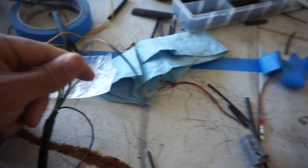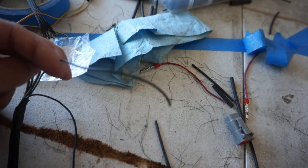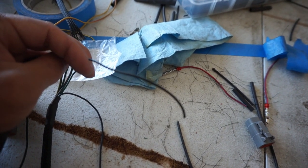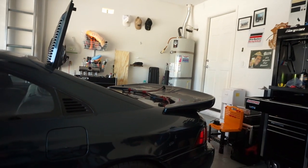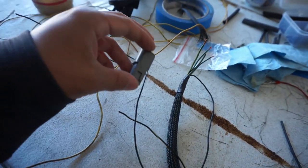Those are going to get pinned onto this DTM connector for easy replacement or removal. And that is that. Then we have this black wire on this one next to the coil — this is going to be our RPM wire, so that's going to talk to the computer and send it over to the RPM gauge. I'm going to finish this up. Gabe's over here working on his car — he's pulling out the spark plug wires, coil, everything, and then he's going to install this bad boy in. So stay tuned. I'm going to put this DTM connector on.